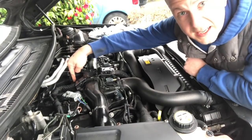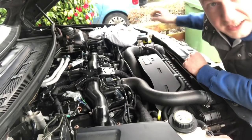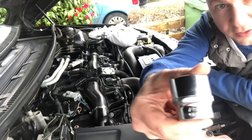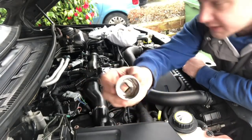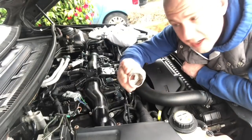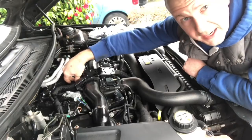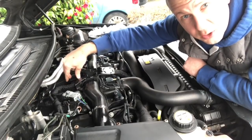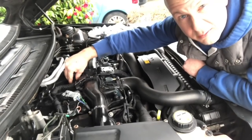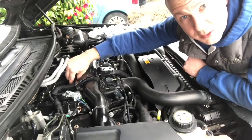In here — I'll show you in a second — is the oil filter. You're going to need a 32mm socket to get that off, which is pretty big, and not all sets go up to 32, so just be aware of that. Get the oil filter housing loosened up, then loosen it a little bit, let the oil bubble down out of it, let it clear a little bit, loads of rags and newspaper, and we're going to take it out.